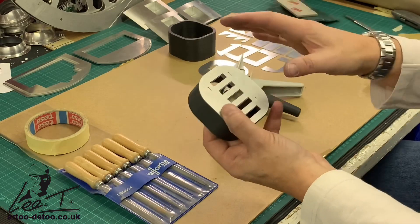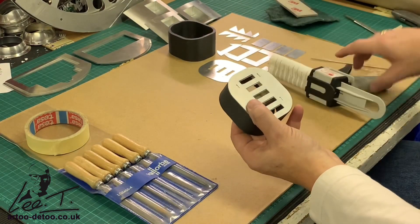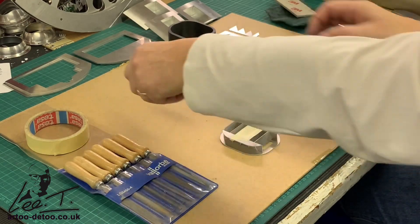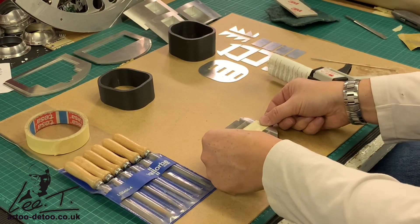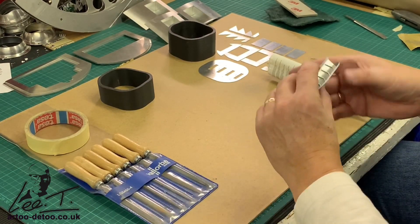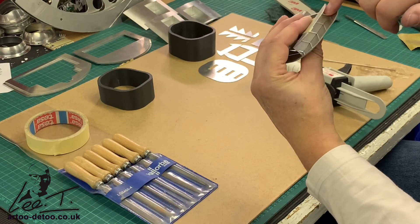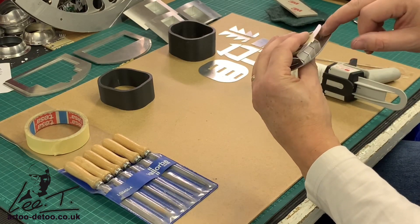I'm not going to do this now because this is a reference piece for the laser cutter so we can get all the folds correct. But then you mix the glue, put some dabs in there, and then when dry, carefully take this out — try and keep it all square. You can eyeball it as well just in case it moves slightly. Then you can just run glue all the way down here on these tabs to hide them. Just make sure you don't get it too close to the edge.